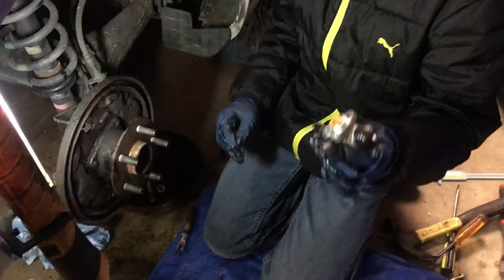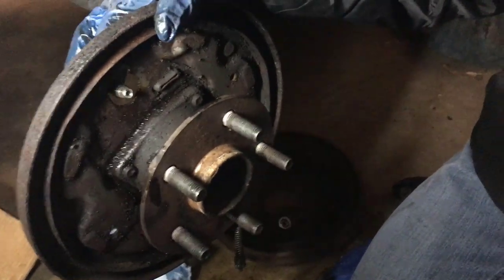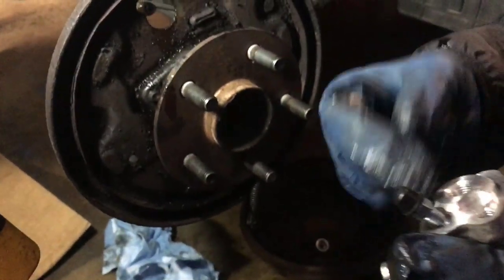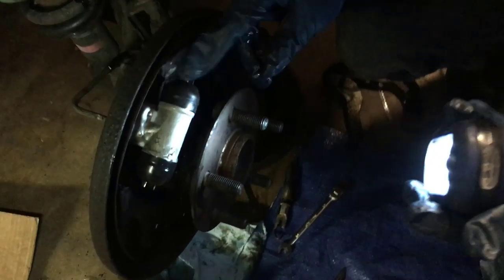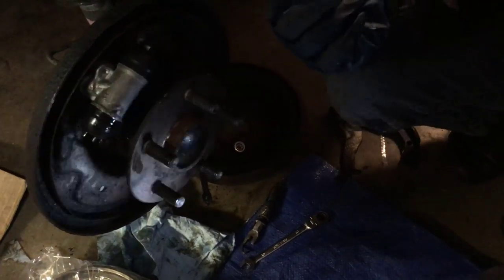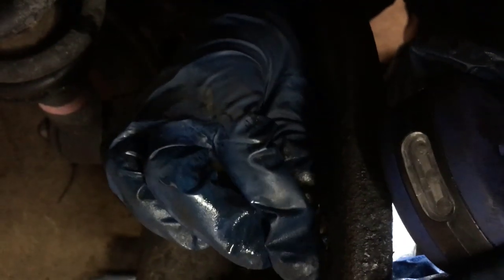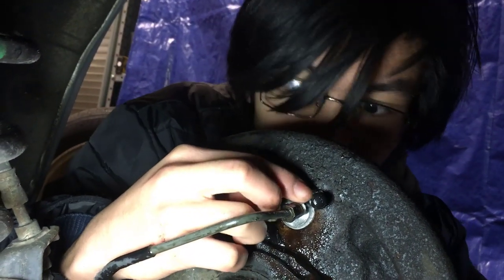At this point we can put the new cylinder back in. First thing to know is that the brake line got pushed back when we took this out, so the next step is pushing it back in and putting it in position. First, I'm going to take this cover out. The bleeder valve and the securing bolt should be on top — you can tell because you're only going to be able to secure it that way. Instead of putting the brake line on first, we're going to put the screw on to secure it. Make sure the unit is on flush before you do this.